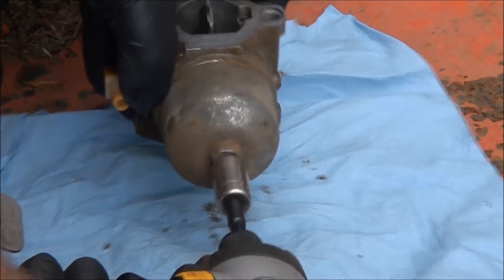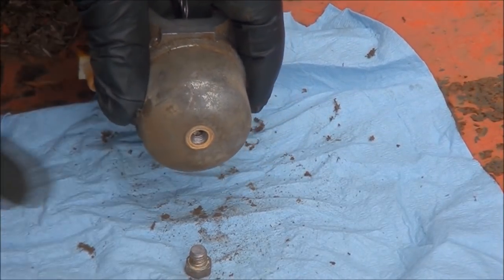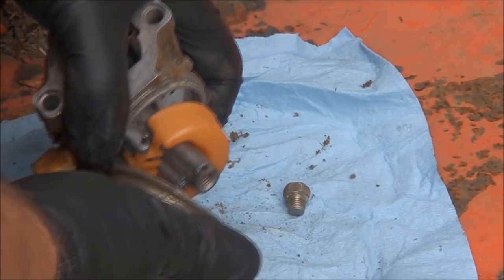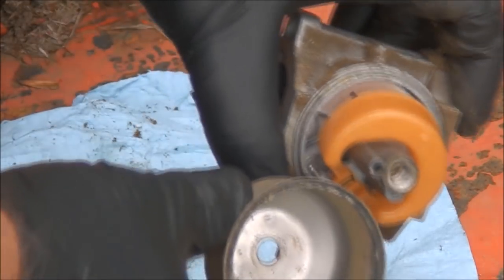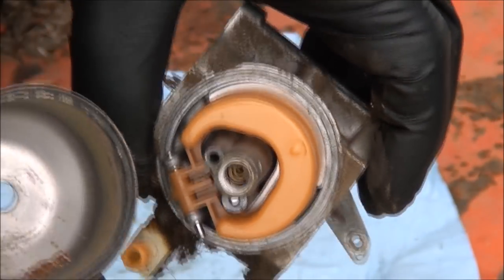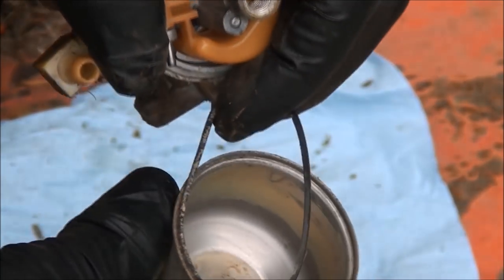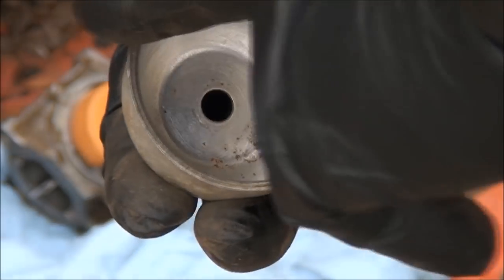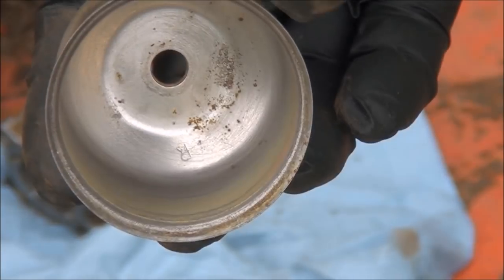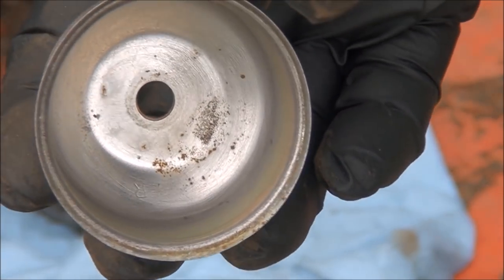I have a 7/16 socket here, which is what you need to take off the float bowl. You have a gasket — sometimes it stays on the carburetor, sometimes it stays on the bolt. So not too bad, but you can see there's some sediment down in there and some areas this carburetor needs to be cleaned. You also have a gasket that goes here and it looks like it stayed on the float bowl. Just grabbed a rag and wiped this out. I've seen much, much worse float bowls. If you do have any rust in the bottom, you want to make sure to scratch that out so it doesn't flake off and plug up the carburetor.